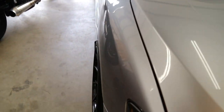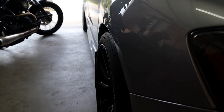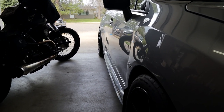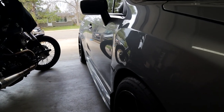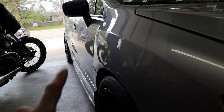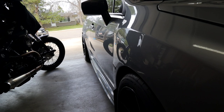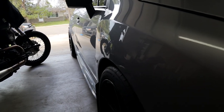For alignment specs, I'm running negative 2.75 degrees of camber in the front and around negative 2 degrees in the rear. All four fenders are rolled. My paint actually looks really really good even though the car is dirty — that's because I had a full paint correction and ceramic coating done by Jags Performance here in the northeast. I'll put a link to that video in the description. The roll center kit really improves the handling feel and makes sure your suspension geometry is where it should be.